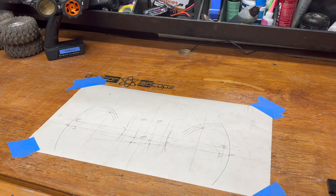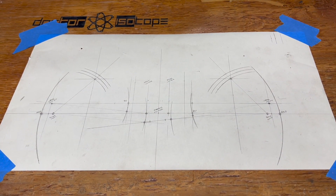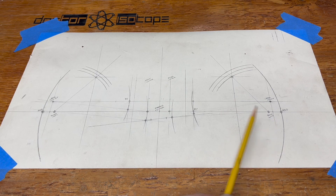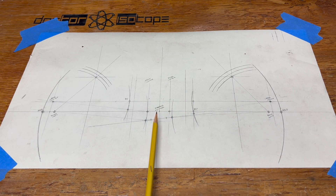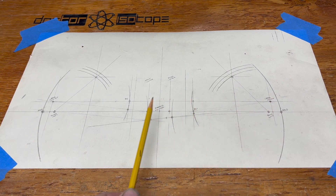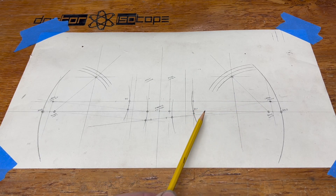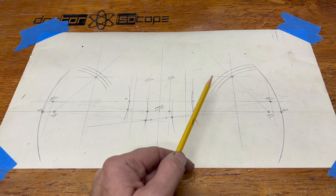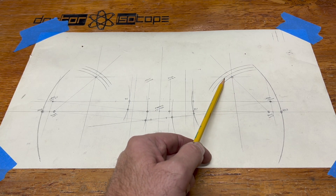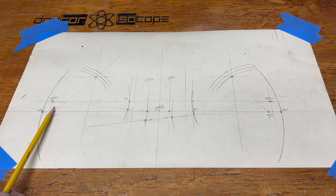I don't know if this illustration will make any sense to anyone. We're just gonna go Ticonderoga on this one. I basically marked out the positions of the axles and then the chassis center, so I could work off the chassis center to keep it as symmetrical as possible. The upper mounts and existing shock mounts on the axles I need to retain. There's the front upper mount, which is quite high. The rear upper mount is down lower — I'm just going off what already existed.